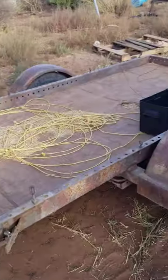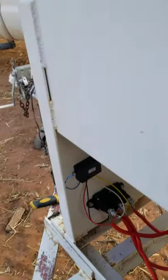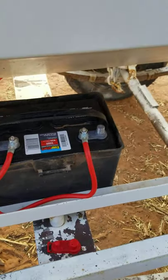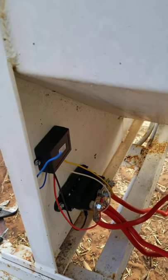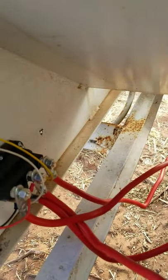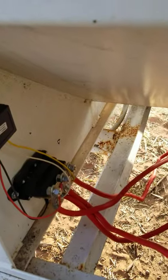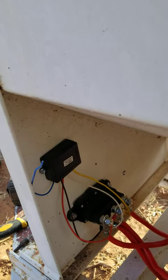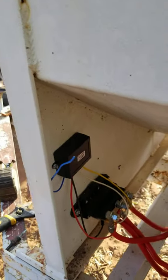I ordered everything off Amazon. I ran it to a marine battery here, which I'm going to mount to the trailer. I got a 12-volt reversible solenoid and a little remote control — that's all, it's simple to wire up. It tells you hot to the battery, negative to the battery, hot to the motor, and negative to the motor on the big battery leads. From the remote control you've got a left side and a right side, which is your in and your out — they use these a lot on winches.